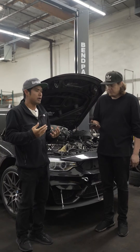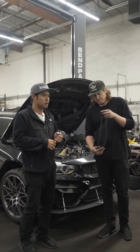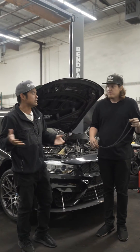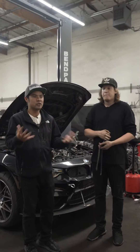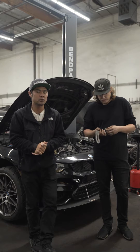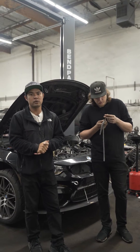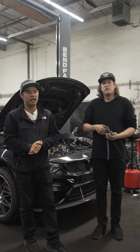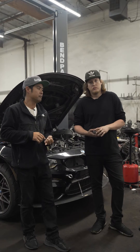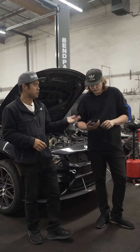The interesting thing with this car is that mainly what we want to convey is that even though the crank hub issue is a thing that we see, there are still some people out there who question if the crank hub is an issue or if it needs to be upgraded. We don't fall one way or the other with it. We just know that because of a sudden change in torque, things can happen with the timing assembly — whether that is the crank hub being the first point of failure. And that's what we see here with this broken timing chain.